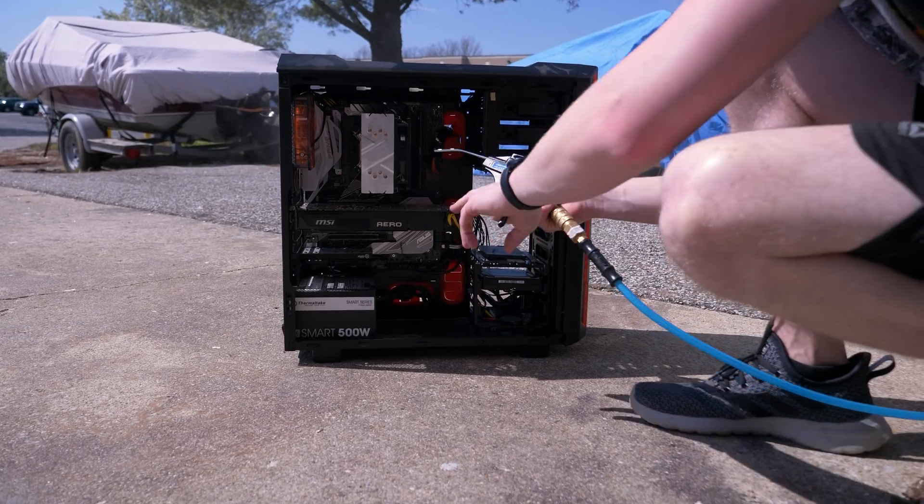Okay guys, so as you may or may not be able to tell, this computer is a heck of a lot cleaner and it's probably going to run a decent amount better. We did a lot of basic cleaning things that you could do at home for your gaming PC. So every year or so — or as often as you really want — I recommend changing your thermal paste. The GPU is not super necessary unless you have a five-year-old-plus graphics card. We didn't need to do it in this situation, but we did just to make sure it was perfect and to show you guys at home how to do it. Overall, very happy how this thing turned out. My brother's probably going to get a new PC within a year or so, so this will hold him over, and maybe you'll see a PC build on the channel when that happens.